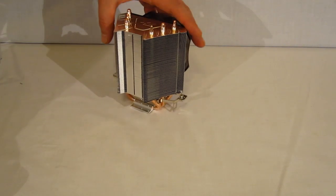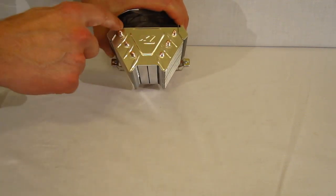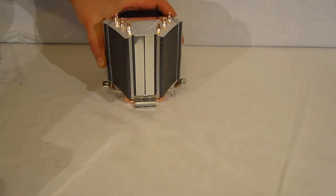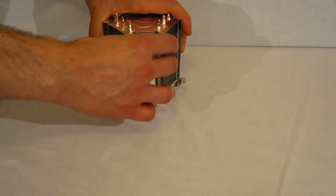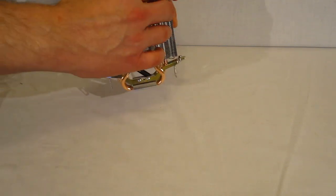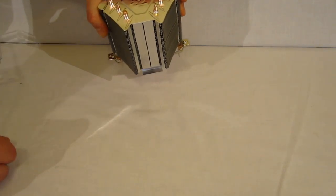Let's talk about the V-shape. You can clearly see here with the heat pipes laid out in a V-shape as well. The back is notched to keep with the V-shape for better airflow. The back is also bent in and sealed, so all of the heat flow is directed through the pipes out through the fins.